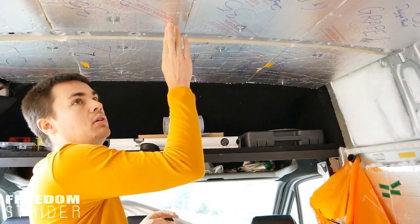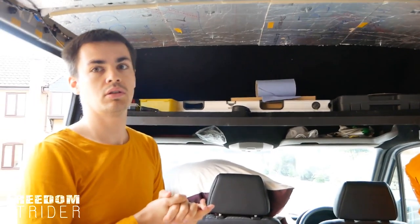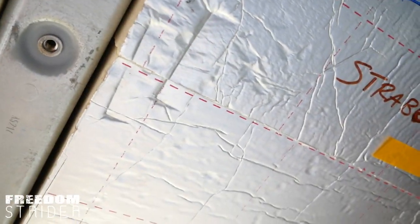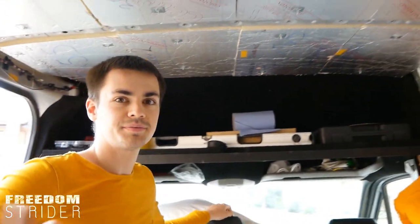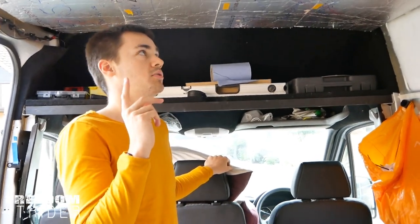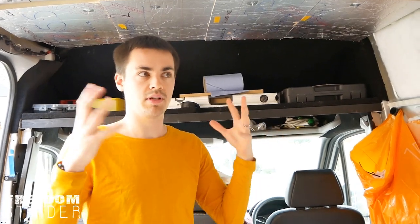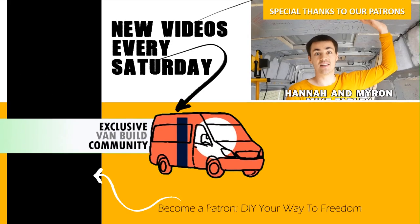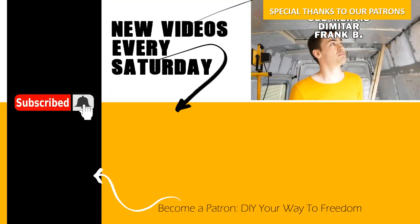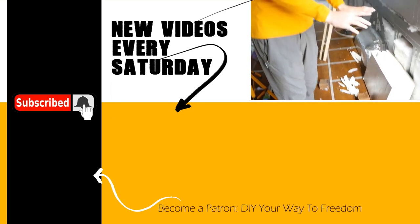The sealant has definitely had time to stick and is dry by now. I'm a little bit concerned about how they're going to handle over time with the motion of the van, so I'm thinking about using some expanding foam to just wedge them really well — possibly in these crevices here. We don't have that big of a gap anywhere, but I think expanding foam will be good for two things: filling the final few gaps for a better insulation barrier, and also sticking it in place since expanding foam is quite sticky. If there are any other ways to secure these better, let us know in the comments below. Ceiling insulation is up and it's not clogging our garage anymore — well, most of it's up, but they will be very soon.